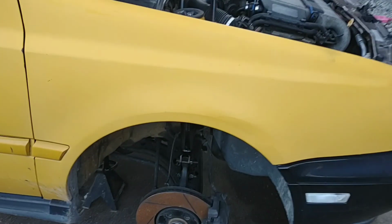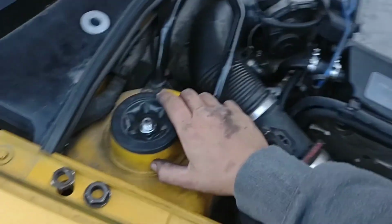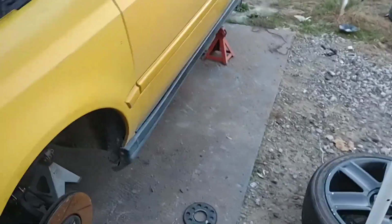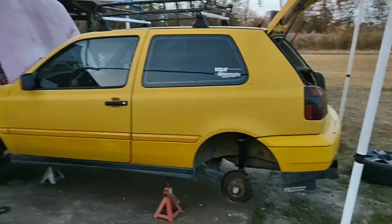All right, everybody. So we're back together, and I basically just wanted to show you this is the finished product. Everything gets nice and snugged back down. There shouldn't be anything up in the top. You notice I can jiggle, and it's not that bad. So there's no play. Ideally, those polyurethane bushings keep this gap up here tight so that everything's nice and snug. Doesn't make any noise when you hit bumps, no rattles, might squeak a little here and there as I'm turning, but man, we're done. I just need to put the wheels on.